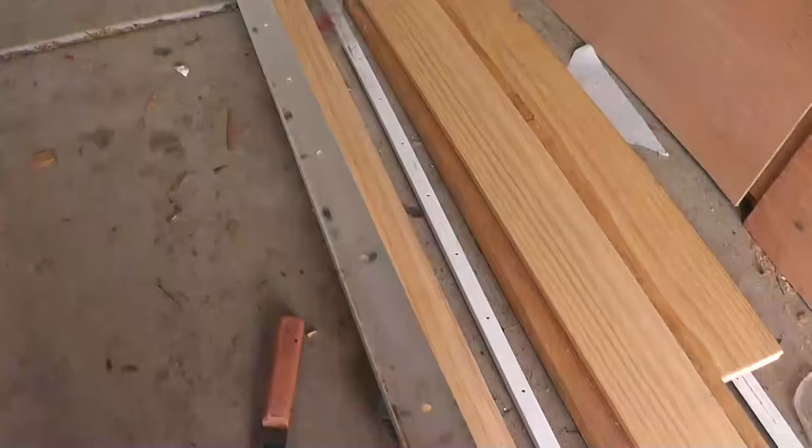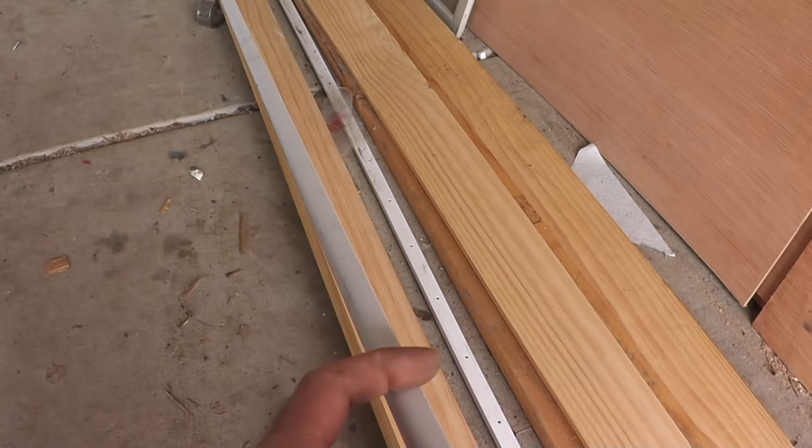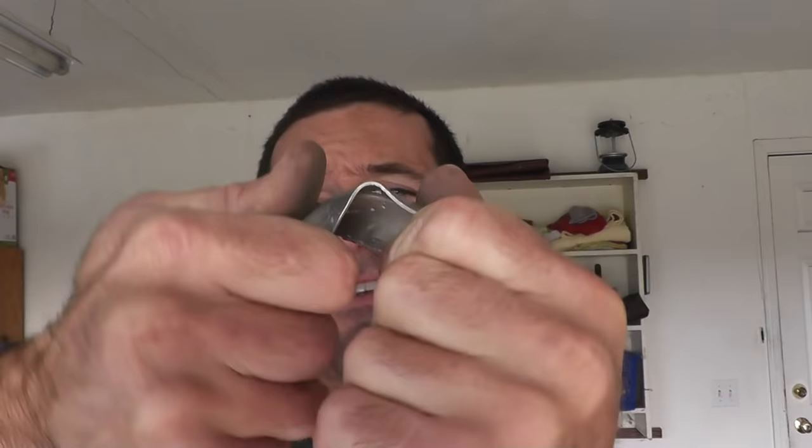Just like the original gutter rail, these will attach to the side of the trailer, but instead of having a channel that runs along the outside edge, there's a lip that extends about a quarter of an inch onto the roof of the rig. I was having some stress about this project because of the difficulty of bending that rigid aluminum around these tight radiuses of the camper. If I try to bend it by hand ever so carefully, instead of making a nice swooping curve, it just kind of crinkles.